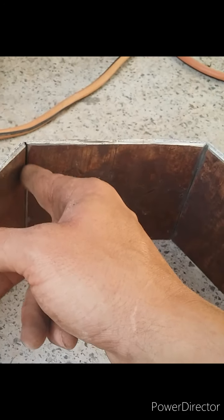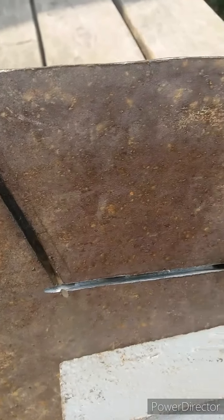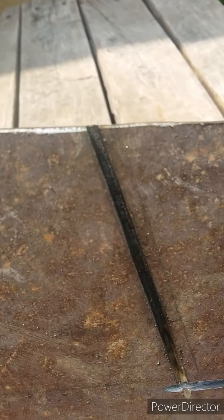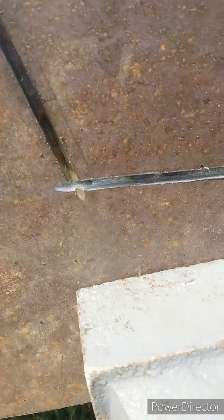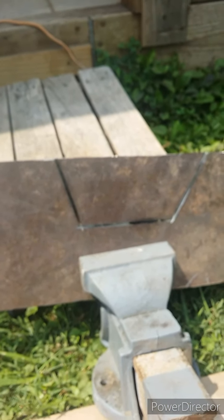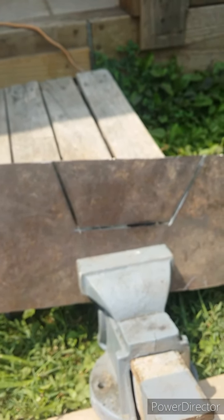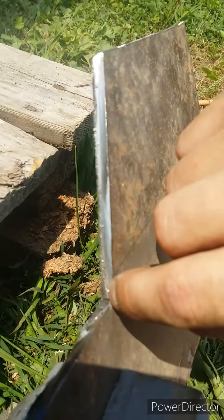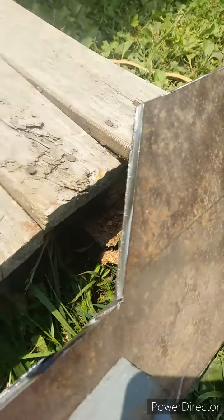Then you can come back with a welder and weld that up and make it strong again. Let's see if we can make this one match that one. When you cut, don't cut all the way through — get it good and hot, get it thin so it'll turn a little color so you can tell. I went ahead and went all the way through right there, so now I'm going to use a sawzall to finish it up. It's been about a minute and a half with the grinder, and a minute and a half with the sawzall — so about four minutes' worth of work including having to stand up and shoot the video.